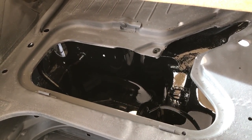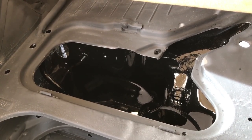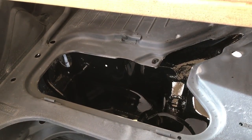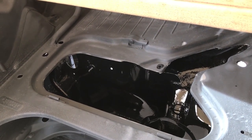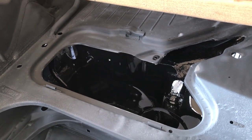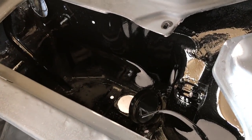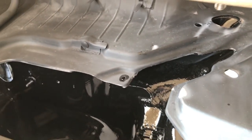That's one of those areas that's just really difficult to spray. Even if you're using an HVLP gun — whether it be a cup gun or a gravity feed — you just can't get in there because of the size of it, so you have some constraints. That's why the paintbrush works pretty well with that product. Get down in there and trim it out.